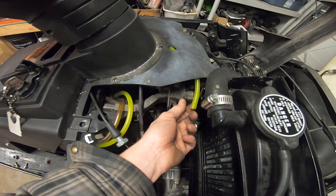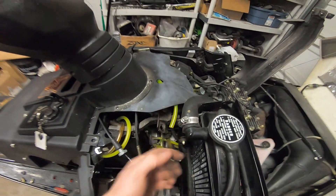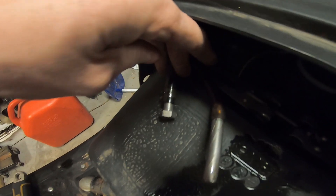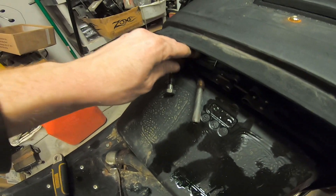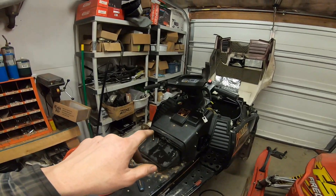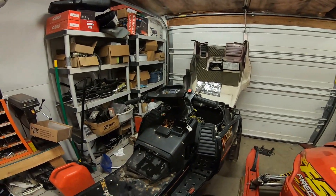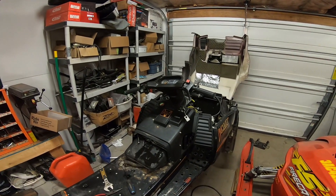I pulled off the line that comes directly from the tank and tried sucking on it to pull fuel — I could not pull any fuel from the tank at all. So I pulled the pickup out of the tank and lo and behold, one of the lines is plugged off with a bolt. There's the problem — hard to pull fuel with a bolt in the line. We're going to fix that pickup; I'll take it from my original tank. It's pretty dark out so I'm not sure we'll finish tonight — we may resume this in a couple of days.